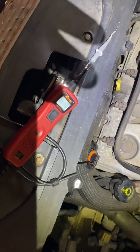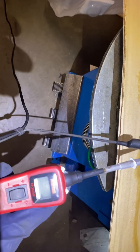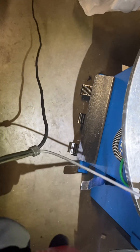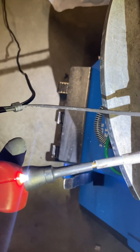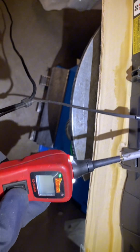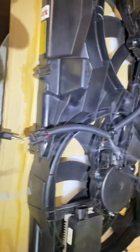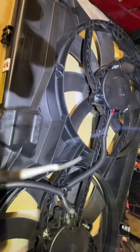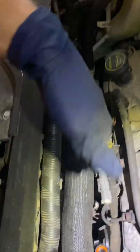I've got a new fan right there. I'm going to test it just to show you how I'm trying to do this. There's the new fan — I've disconnected it from the module. I've got that hooked up to the ground. You can see it's showing an intermittent ground signal because I'm not getting a good connection. There we go — you can see a solid ground signal. Watch what happens when I give it some power. It works. I'm burning up my little connector here because that's a lot of juice going through that tiny little wire — but I was only getting pulses of energy there. Now we know that these fans are completely smoked.